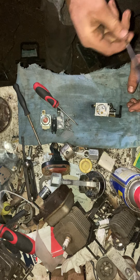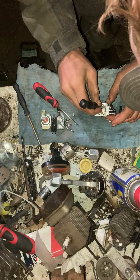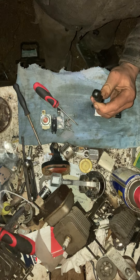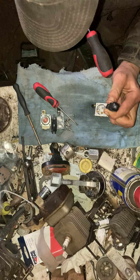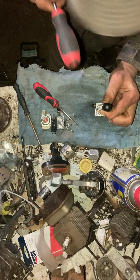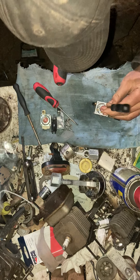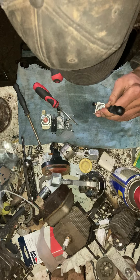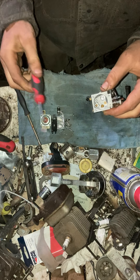I'll put a link to the toolkit I have in the description. I'll add to the tools listed there. Get your double-D driver — which you'll find out about if you click the link in the description and buy the kit. Center it on the welch plug, get your Phillips, and give the driver a couple of light taps. That welch plug is not coming out again unless you pry it out with brute force.